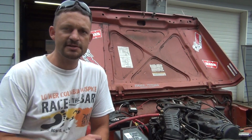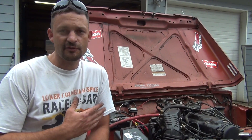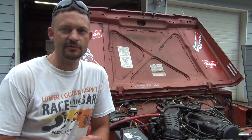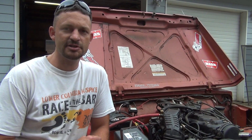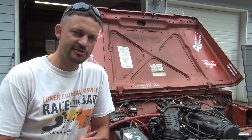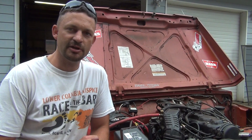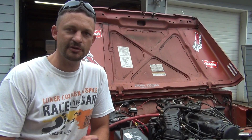This has a 1.6 Sidekick engine in it with throttle body injection, and honestly there are not that many vacuum lines. It would probably be pretty easy to find the leak just by going hand over hand on all the vacuum lines. But I've got this smoke machine that I've been using, and it's super handy. It'll definitely find this big vacuum leak, but it may also turn up some smaller ones I wouldn't normally find going hand over hand. So we're going to set that up and I'll show you how I use it to find vacuum leaks.